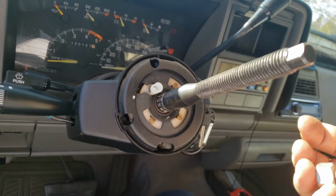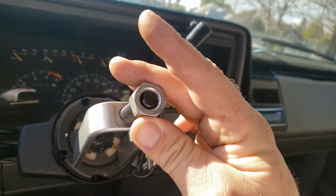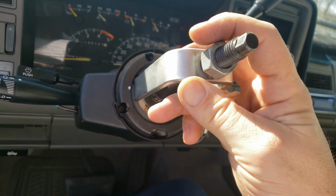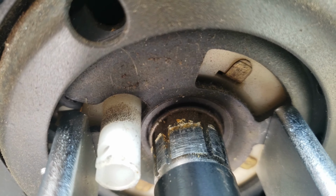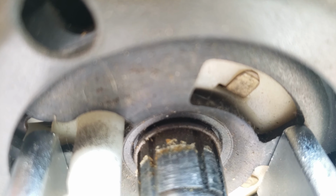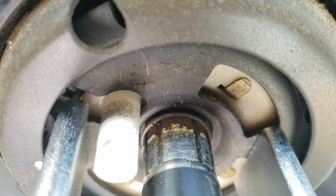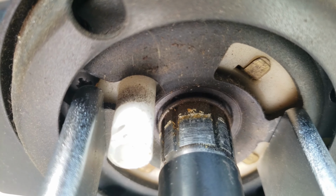So we're going to set up the black adapter again, the larger black adapter with the big flared end goes over, and the smaller horseshoe thingy, and then you thread on the nut, and that spring is only going to compress a little bit. You get look in there. We're looking to expose the lock ring in the groove, and it's not touching anymore, but the more room we can get in there, the better. And that feels about it. You're not going to get much further than that.